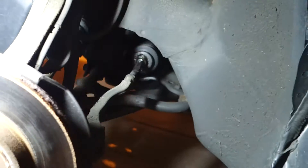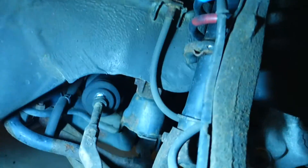What I'm planning to do is transfer the entire subframe — the knuckles, lower control arms, and the subframe on the front along with the shock and strut — and literally drop those into the Civic. Take out the Civic's setup and put this one in. It all fits except for the upper control arm. I also want the front and rear brake conversion. I'm hoping it all fits, but that is the plan.